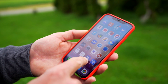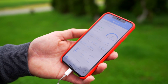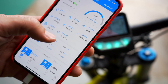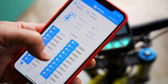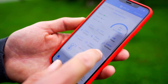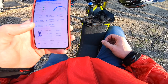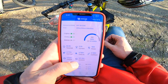To connect to the BMS I'm using the NBMS app, available for Android and iPhone. Right away you can see a lot of interesting information like overall voltage, the highest cell, lowest cell, cell difference, and temperature, where you can see all the cells. It's good to check sometimes what the temperature is on hot days inside the case.